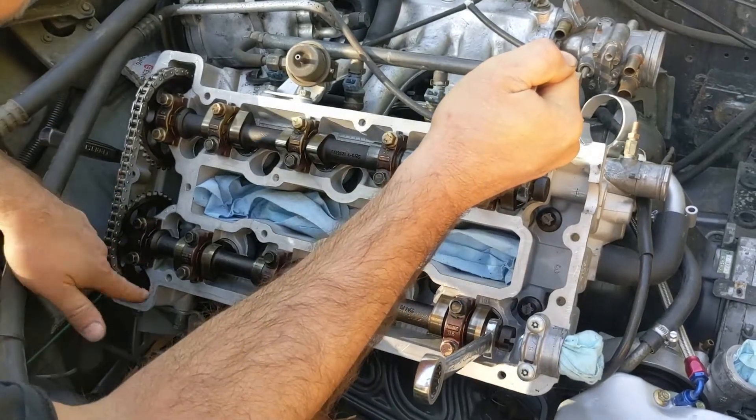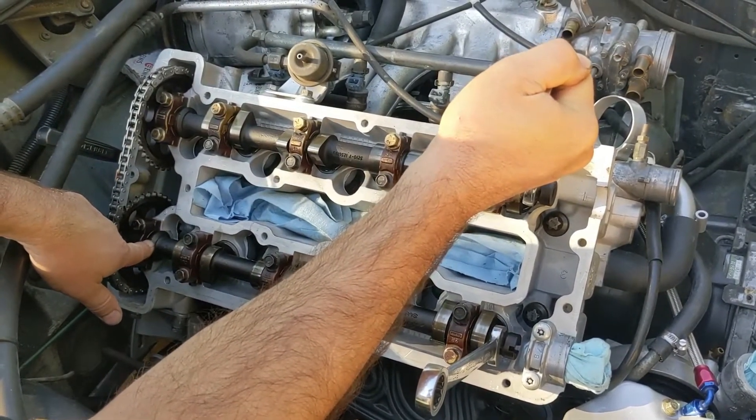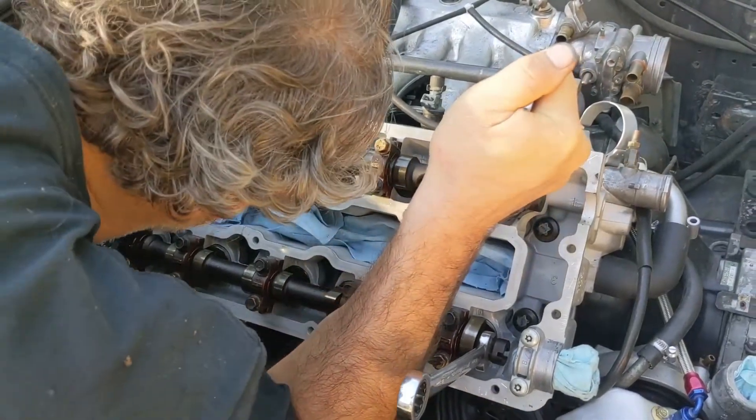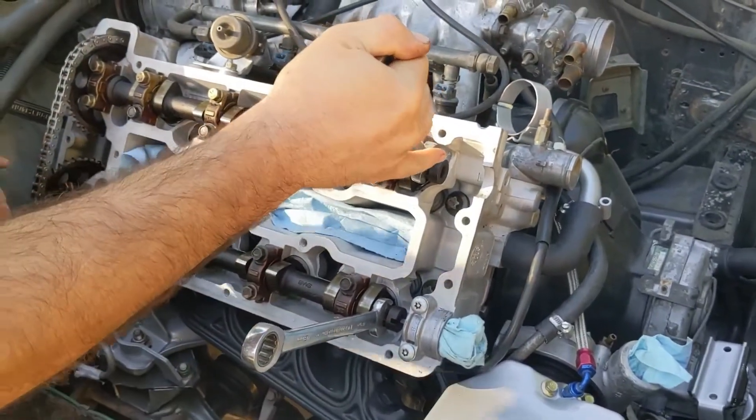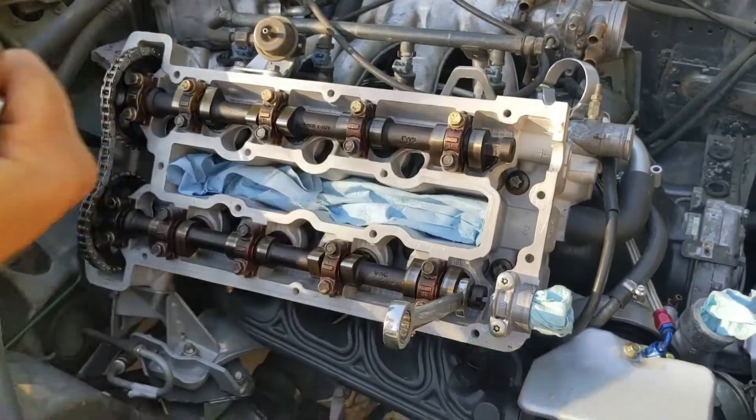What I can see is that I have alignment here on the exhaust cam - follower to cam. And I have alignment here on the intake to follower. Let me get my head in there to make sure I'm seeing it correctly. This is perfectly aligned. I'm going to let this go, and we're done.